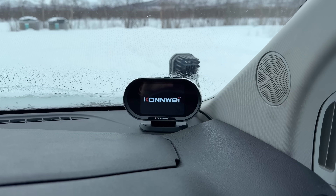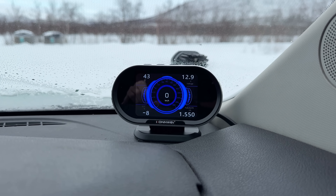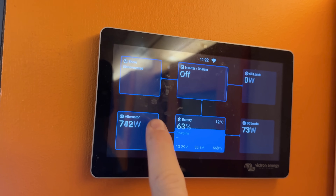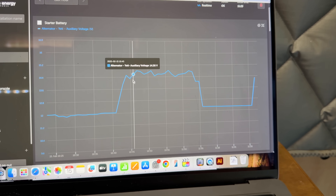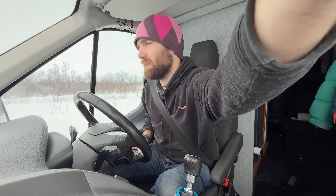It's 6 degrees. I just preheated the engine a little bit earlier. It should go up nicely to 14 volts and stay there for a bit. On the screen in the back we should start seeing the alternator chargers come on — and the auxiliary voltage has gone up. The main thing I want to test is: when it drops down, the chargers turn completely off. When I have the lights on it goes up to about 13.6 volts. I want to see it drop down to zero, then turn the switch and see it go back up. We should hopefully be able to see the effects on this chart showing voltage changes. Let's get driving and see if I can get smart regenerative mode to kick in and then test my switch.